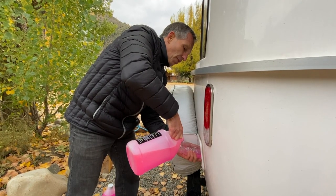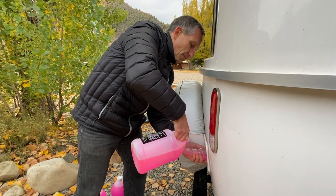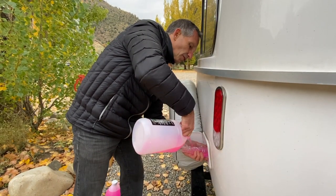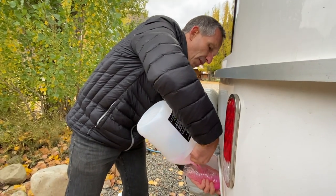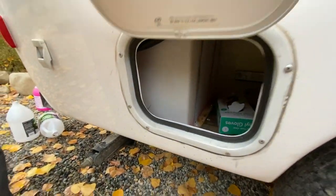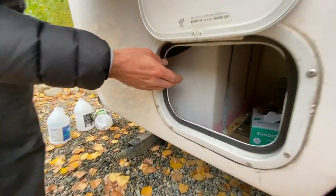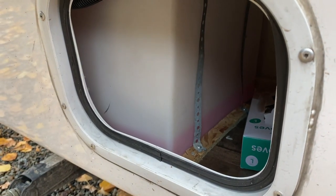Our RV is pretty small, so we only need a couple gallons. But if you have a big RV, you'll probably need a lot of gallons of this. Remember, if you do it right, you can recycle and reuse a lot of the antifreeze. It also depends on where your pump inlet is — if your inlet is at a low enough point in the tank to really get that tiny bit of antifreeze you put in there. I'm going to put another gallon in to make sure the pump can get a hold of it. I've got about three gallons of antifreeze in here now, so that should be enough for the pump to fill the lines and start coming out.